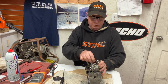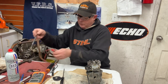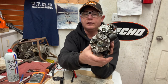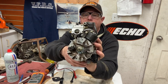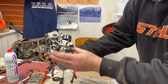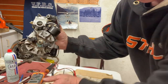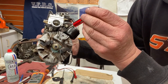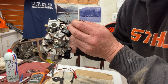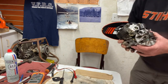Put your meter to ohms, to the little beeping sound — hear that? On these flywheels you'll see right there it says IGN — ignition — with a little arrow. You want that little arrow lined up so the ohmmeter stops beeping when that arrow lines up with the bottom of the lamination of that coil. If the points are too closed it's going to fire past there; if they're too open it's going to fire before there.